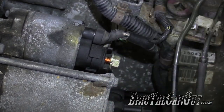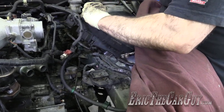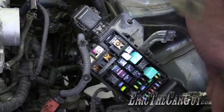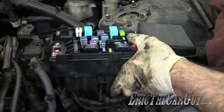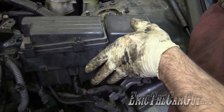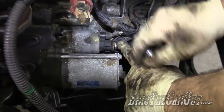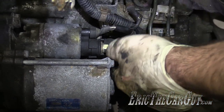These are tricky because the stuff is running outside, so I just pull it back, make sure the metal is making contact, and then push it in. If you miss that you'll get a bad connection and intermittent starting. Here's my starter cable — I need to reconnect something from the engine harness. I have to leave this loose because it needs to attach to that brace. Positive battery cable and the starter — this is a 12mm. Same as with the alternator: turn it too much and you'll break the internals of the starter, so be careful.